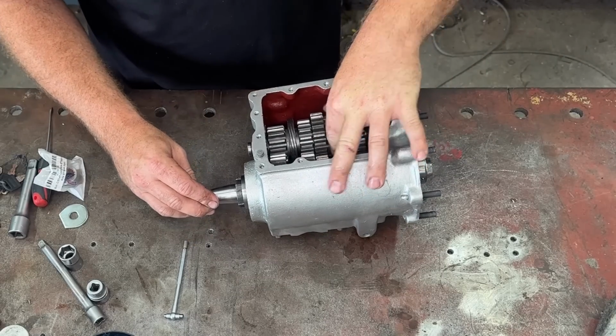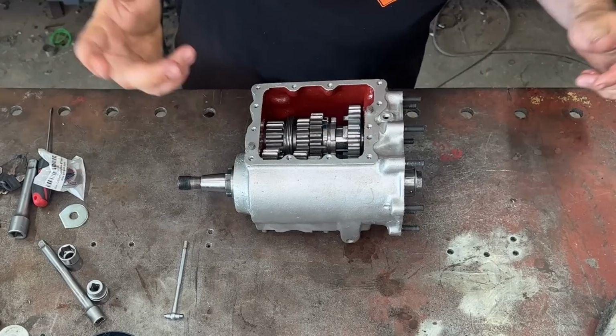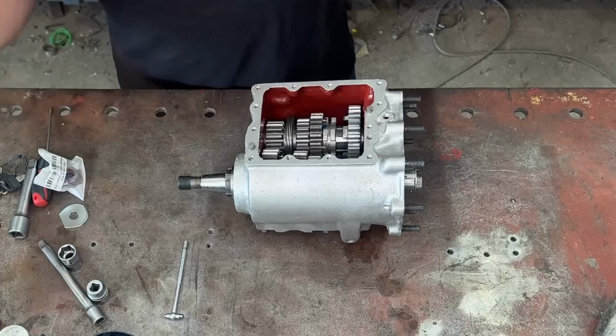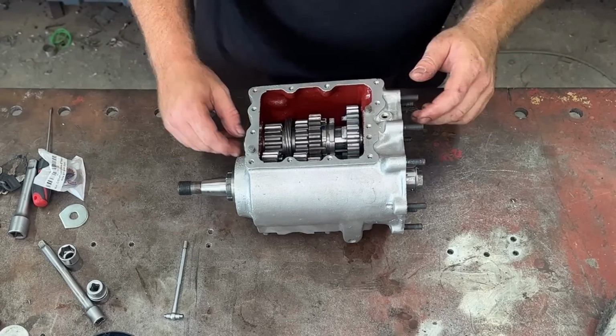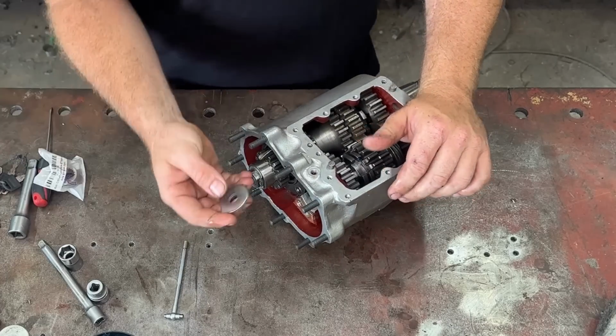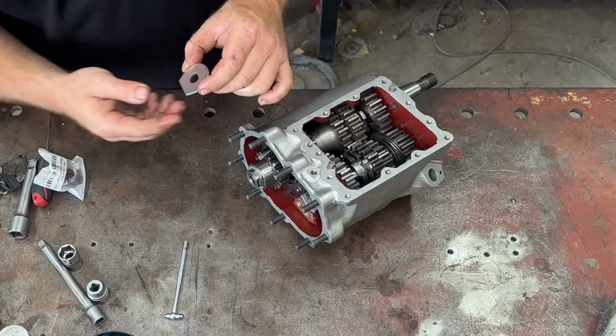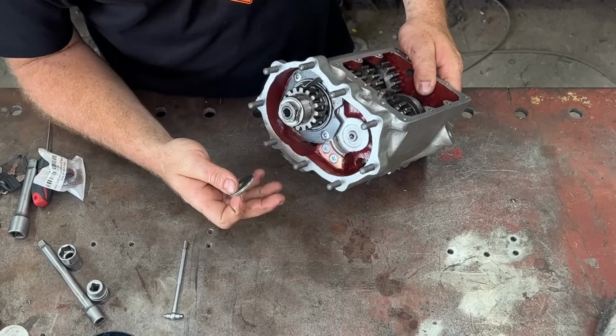but look at our float, it is freaking mint. Tiny little bit of float there. Exactly what we want. So thank fuck for that. So I'm gonna go through, put this O-ring on here, lock up. Remember, we gotta put our little washer on there with our nut. That stops our counter shaft from spinning. So I've got to put all that on.